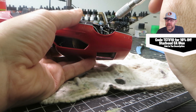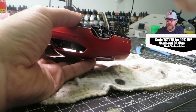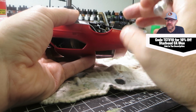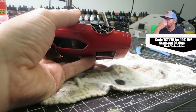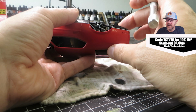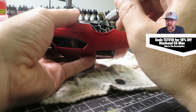The only thing is, because we dropped the rear axle, this axle sits lower down that way. Now, the anti-sway bar, you can see, is hitting the axle and doesn't quite make it up here to the shackles or up here to the leaf spring perches where it needs to make its connection. Not a big deal. I think what I'm going to do is I'll just build a link that goes in between.